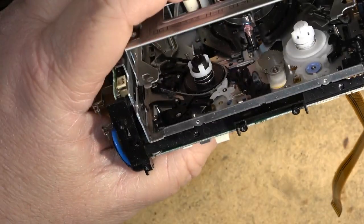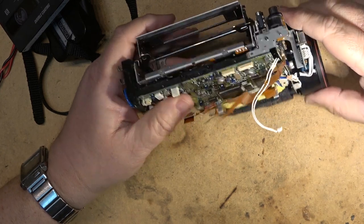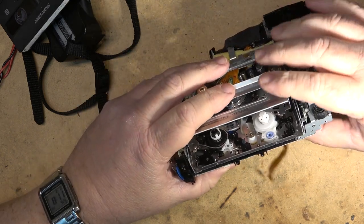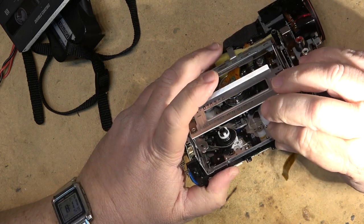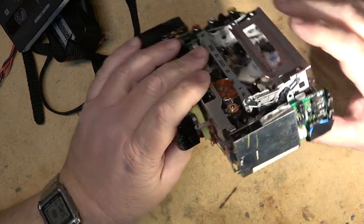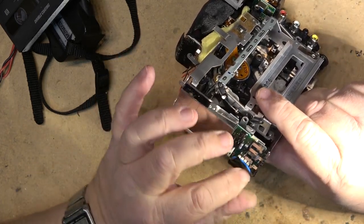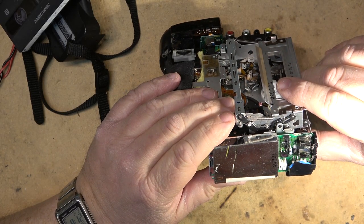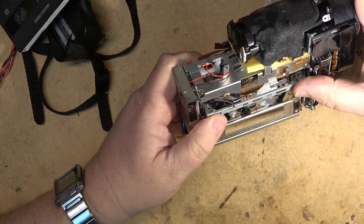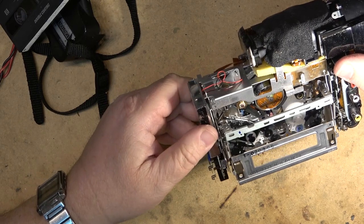At this stage of the game I'm going to say this one is shot — this camera is just beyond repair. It may have been salvageable if someone hadn't tried to take it apart to get the tape out. The mechanism is certainly jammed now, and whatever else went wrong with it, more than likely the DC to DC converter failed — that was a real common problem on all these Canons.